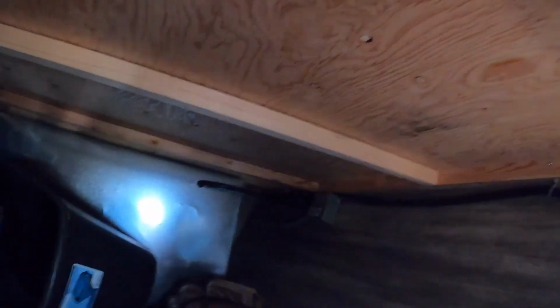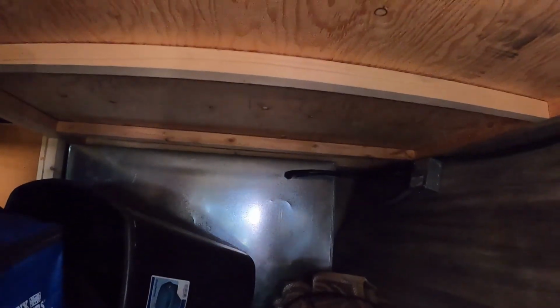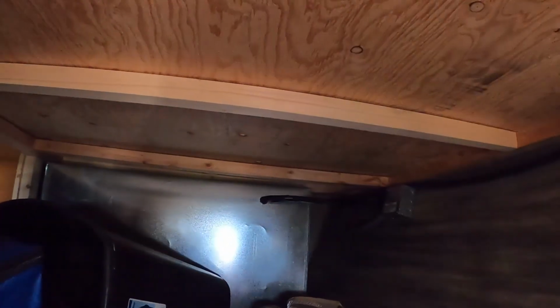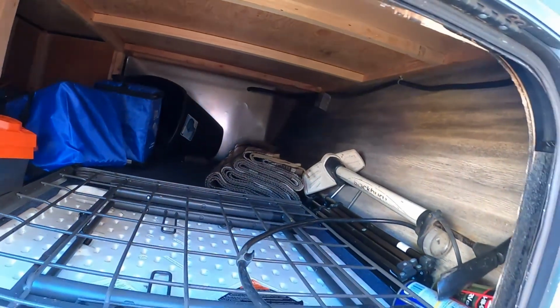Now the 110 volt lines, the reason I wanted that junction box here is you have to crawl all the way down in this compartment, and this box right there is where all your high voltage connections are made. You can see that wire comes out of the split loom, out of the back of that. I made a video of me down in here making those connections, and I'm sure it was boring anyway, but I'm kind of ticked off. It was super hot and super cramped. But there are 3 wires inside that box, the 3 wires that come out of your generator: hot, neutral, and ground. You just connect those, and it's color coded. It's very easy.